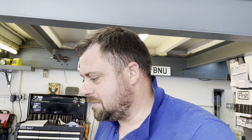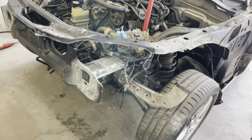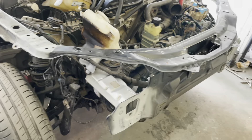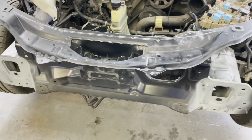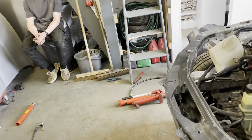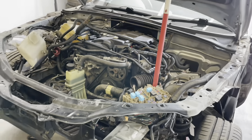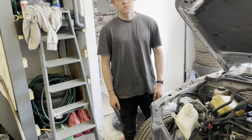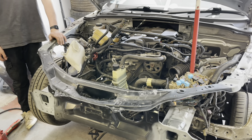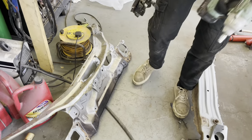We've got all the welding finished — the new front panel's welded on, a bit of seam sealer, a bit of zinc primer to help with rust protection, and it's all looking pretty good. Charlie's been scotch padding it all down because we need to paint this in silver. We've got an aerosol can of silver paint. We'll mask everything off and while it's so hot the paint will dry quick. We'll do it the way Mazda do it — we won't lacquer the inside. Mazda only base coats it, same with the wings if you look at the originals — they're only base coated on the inside.